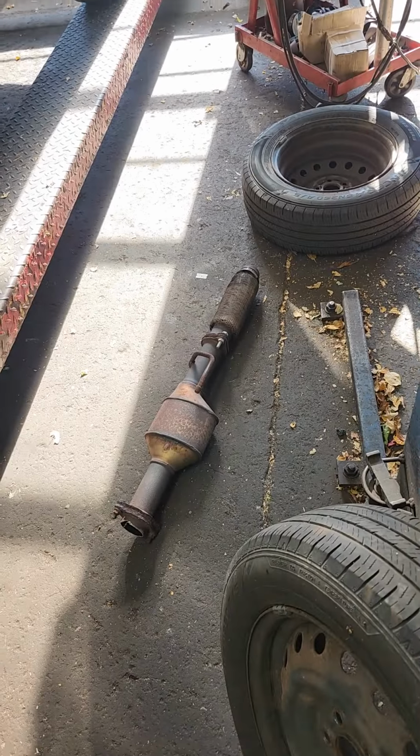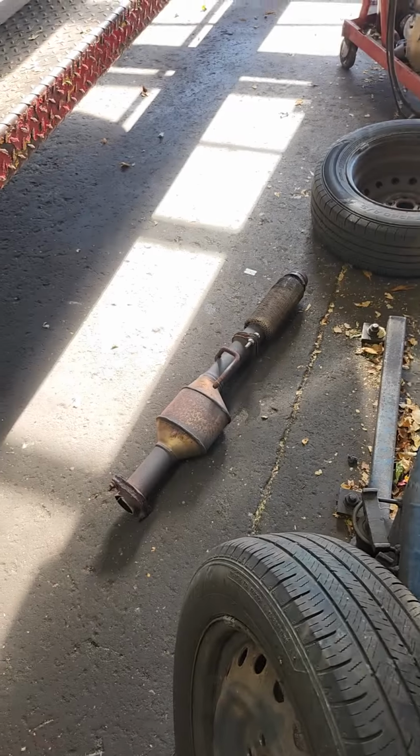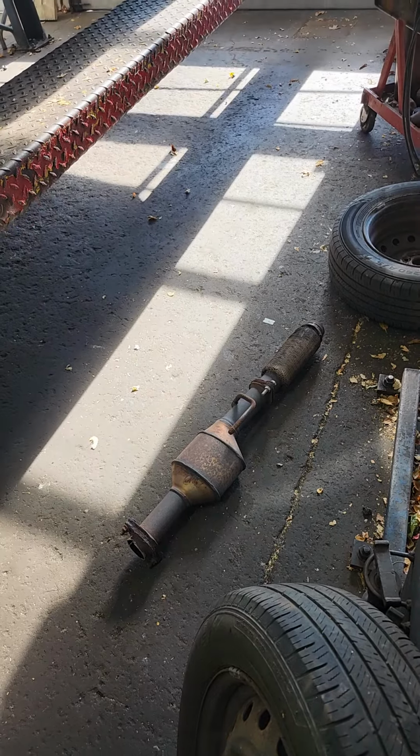So that's the old stuff. Years, 150,000 miles, your exhaust system's near the end of its useful life, in its entirety. Still an affordable repair option versus replacing the entire exhaust system. And I haven't seen a center muffler and rear section of these go bad yet. Manifold converters constantly from people not taking care of them. Flex pipes failing constantly. Customers not aware that the front motor mount's bad and trans mount's bad. This is the most affordable solution for this vehicle.